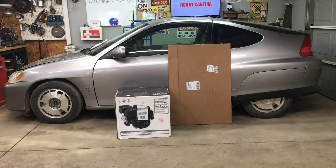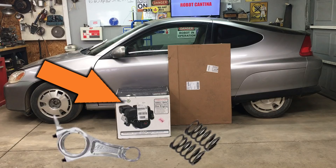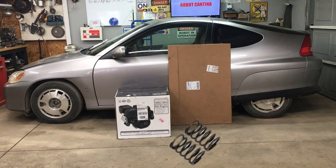Now, some of you may have noticed the big box at the beginning of the video, and I'm sure many of you are hoping for a 670 — well, that's going to happen, but just not today. Today, we have another 420 Hemi to unbox, except we ain't going to unbox it. If you don't know what a 420 Hemi looks like, go back and watch the previous seven videos — it's the same engine. We picked up a new 420 specifically to do the turbo build. This engine's going to get broken in, and then we're going to disassemble it and replace the connecting rod with an ARC billet rod, and while we're in there, we're going to go ahead and upgrade the valve springs. We're not looking to overbuild this engine — we just want it to survive.